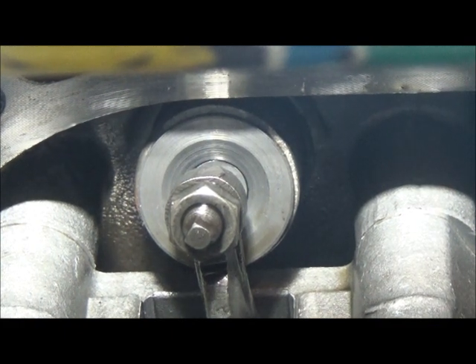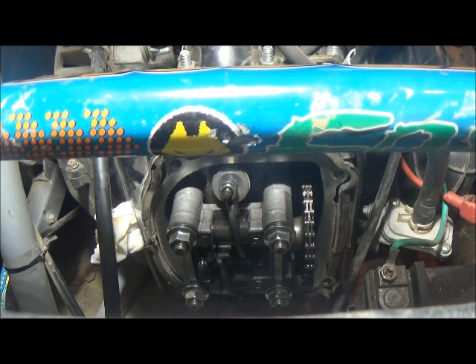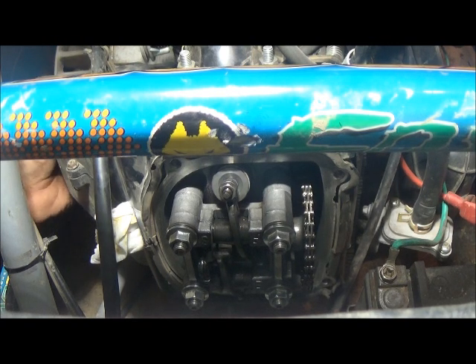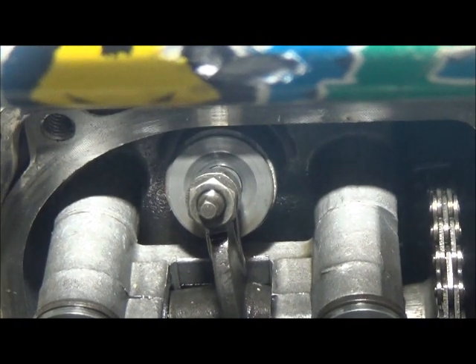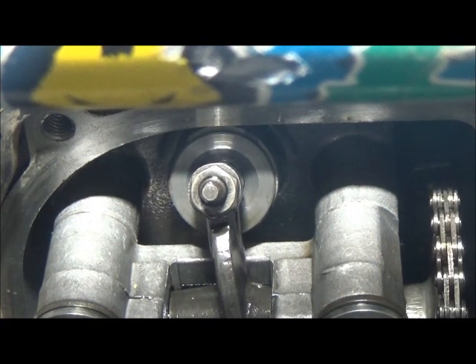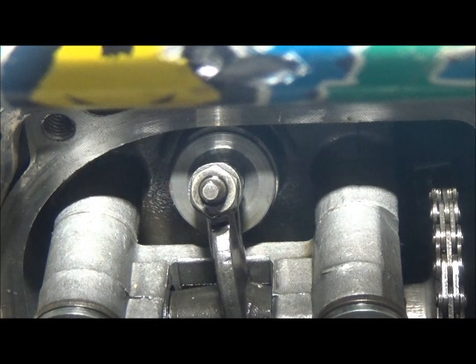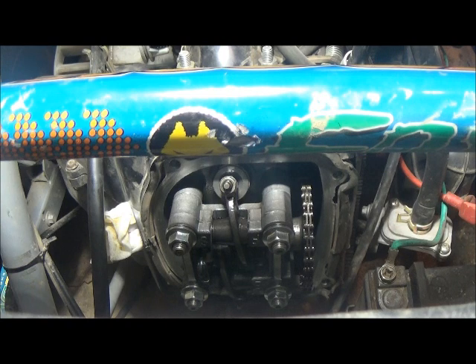Since this was running before I'm going to skip doing the exhaust, and I'll show you the all-the-way-down point on the intake so you can just copy that on the exhaust. You just keep spinning your flywheel clockwise and as you see it's starting to go down — which is going to be the intake stroke. It's going down, going down, and it's starting to come back up, so I go backwards just a little bit. Then I advance back until I feel like I'm at the farthest point down — right there. And then that's where I would check the exhaust.